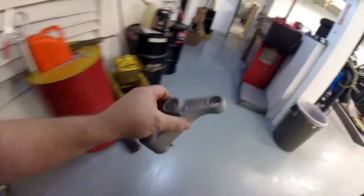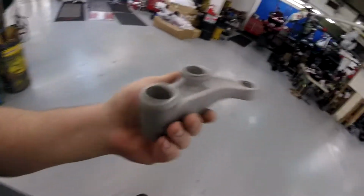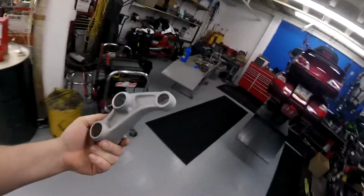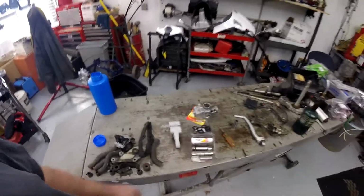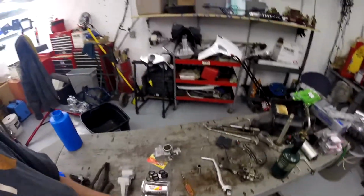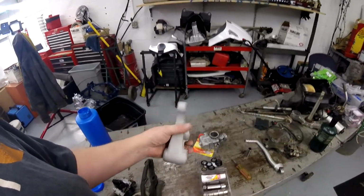As this is out of the bead blaster, you want to make sure that you don't go after those bearing surfaces very, very coarsely. You know, it's impossible not to hit them when the holes are open like that. But you want to just blast around, make the part look nice. Truthfully, these swing arm linkages are down way under out of view, and they get pounded to hell by chain lubricant, grease from the bearings, gasoline coming out of the float bowl vents. I mean, this part gets mucked up, so it really doesn't matter. So, you know, I am going to paint this an aluminum color just to prevent corrosion. I don't know that it could corrode with all that muck that's going to get all over it, but I'm going to paint it anyway.